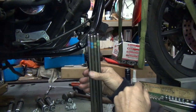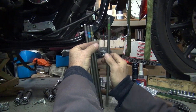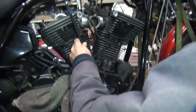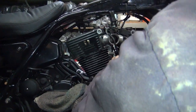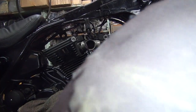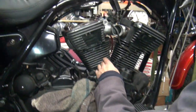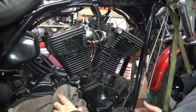There's also a difference between these two over here. Even if you didn't have the right color code, you can figure it out by looking at it. The intake is the hardest one to figure out — if in doubt, lay it up in there. See how it's almost straight up and down? This one here is slightly more forward, so it has to be slightly longer. You can also look in the book or put adjustable ones in. There's a lot of ways of doing things.